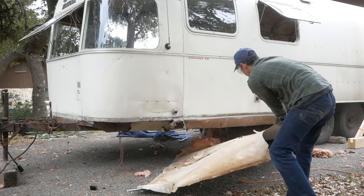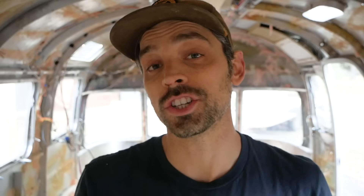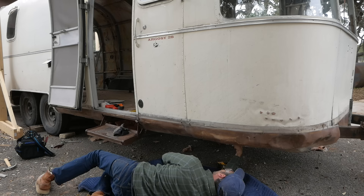Having done that, I realized I didn't need to go through all that trouble to crawl in there and get that aluminum belly pan off. All I needed to do was unrivet the side wraps to get the shell off. So if you're watching and you're trying to learn how to do this process — which I'm doing as I go — if you're pulling the shell off, just unrivet the sides where the belly wrap comes and meets the side. The elevator bolts you can access them once you do that, but even then they're so rusty you end up having to cut them. So it was a lot of work I didn't need to do. It's a lot easier to do with the chassis hooked up to the gantry cranes, higher up, and everything off of it. Lesson learned — wanted to share that with you guys.